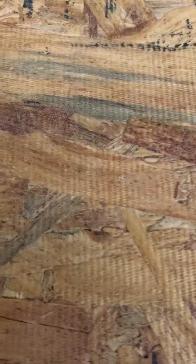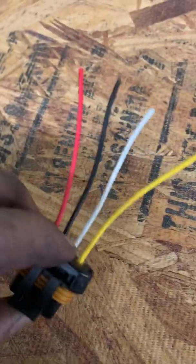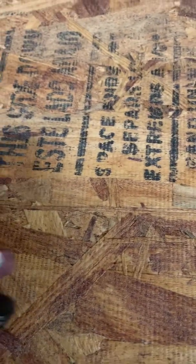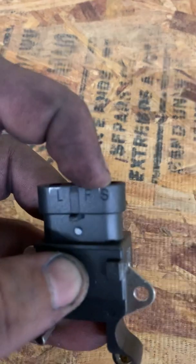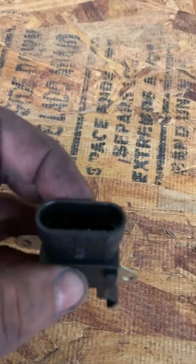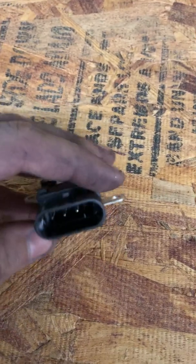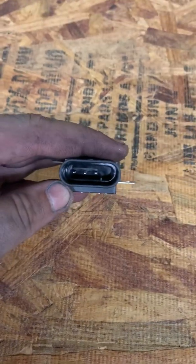One thing I will say for sure: a lot of people ask what wire to use, what color, etc. — that's not really important. Wire color isn't important. What's important is the label on the actual regulator. If you can see it, it says 'S' on it — that is 'sense.' The sense terminal is the important part. It would be the furthest to the left when you're looking at the regulator from the alternator.